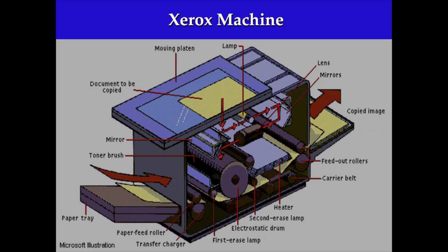The parts of the document that are blank, the light will go through it. So what will happen is where there is writing on the document, the portions of the drum will not be illuminated, and so the negative charge will remain on the drum. What you do is you send toner through there which is positively charged. The positively charged toner will adhere to the negatively charged selenium because it's not being exposed to light.